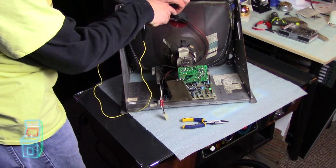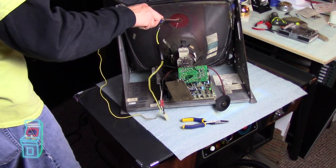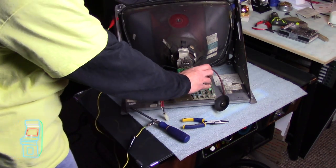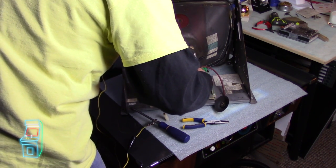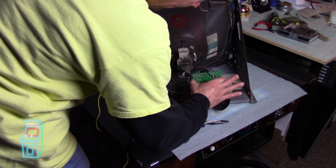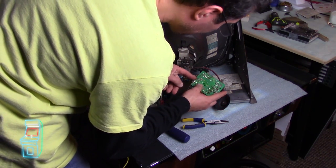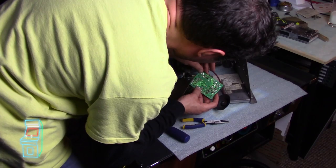Once you touch it and hear the pop you can carefully pop it off. I usually do it again just in case - some people like to wait a few minutes. What I'm going to do is take the neckboard off. Just slowly work it around and wiggle, but not too much. When you're putting it back on, never put it on with the edges - push in the center to support it because that's how they snap in half. I'm going to visually inspect the solder joints quickly to see if anything needs to be reflowed.